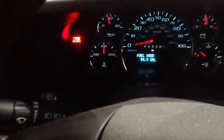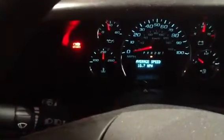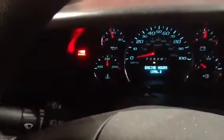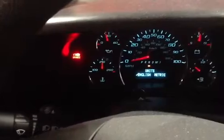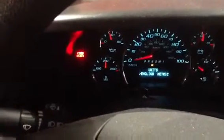It doesn't apply to this situation with the CNG buses. A timer. I know a lot of you guys do use the timer. Average speed, tachometer, and then it blinks and you can turn it back to the mileage. This here, it checks your engine hours. You see the engine hours on here. Me and Ted use this to reset the oil change life on these vehicles. The diesels, they do have a fuel filter life that we do reset.